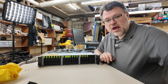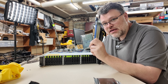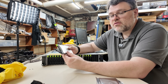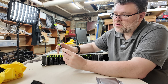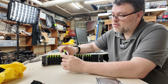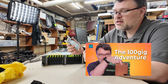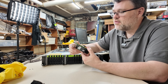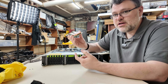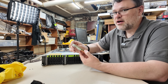I've got my CPUs and RAM installed, and now it's time for our Kioxia CD8P storage. I really like what Gigacomputing has done here with the tool-less design. One of the big improvements with E3 and E1 drives is built-in LEDs — when you close the tray, the LEDs come from the drives themselves, not the backplane, and that turns out to be a better source of truth. We're going to be using our LR-Link dual 100-gigabit Intel NIC with full OCP3 bandwidth and connectivity, so you can move things at a ridiculous speed.